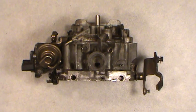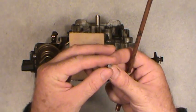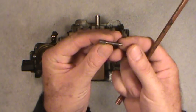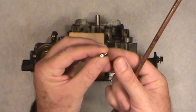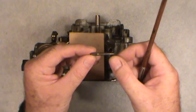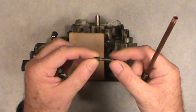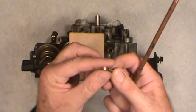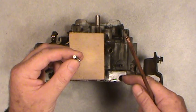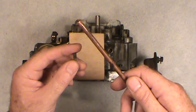I can actually show you the idle mixture screw that's out of the left-hand side here. It doesn't have a slot in the end for a screwdriver or anything like that. It's a hexagonal head — six-sided — and then it's got a thread on it, and then your taper that goes into the throttle body to adjust the idle mixture. But seeing as how it didn't have a slot, and I had a very limited area because the hardened steel plug shell is still in there, I found this piece of copper tubing and thought about what I could use.